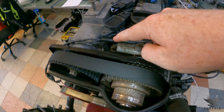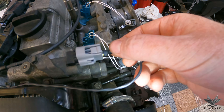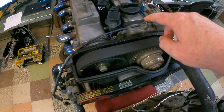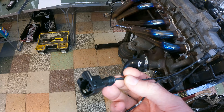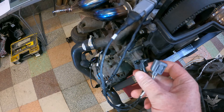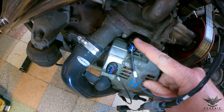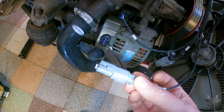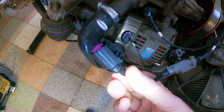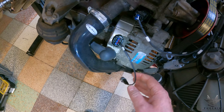Then we're going to carry on along here and have another breakout at the front of the engine. The first breakout is going to the oil control valve. You'll see it's a little bit thick here because we've got the flyback diode installed directly behind the connector. The next section is coolant temp - the customer has got two sensors in. One is the standard IS200 one used for the dash, and the other is a Bosch sensor used for the ECU. On the GTE version those are located here at the front. Moving further down it breaks out at the bottom - we've got our crank sensor that plugs straight in. We've also put a MAC boost valve allocation in there should the customer want to add one. Then we've got his alternator - a VW alternator - with his alternator extension there, plus a standard one just for testing purposes when we run the engine.